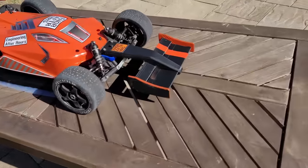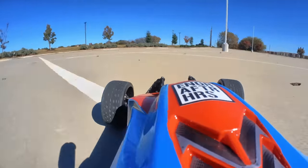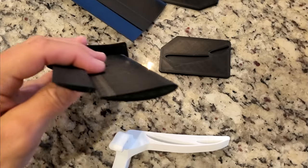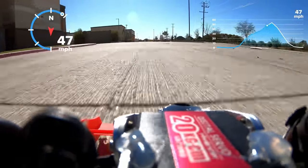A few quick notes: the front wing probably limits the effectiveness of the under tray slightly, but I'm using it to balance the aero overall since it's heavily biased toward the rear due to the under tray's position. This car understeers badly because of the Traxxas Slash's poor weight distribution combined with a relatively high center of pressure, so I'm trying to limit understeer as much as I can. For details on the wing design, I covered those in my active aerodynamics videos — in short, they each produce around 2 to 2.1 pounds of downforce at 45 miles per hour. Thanks for watching!